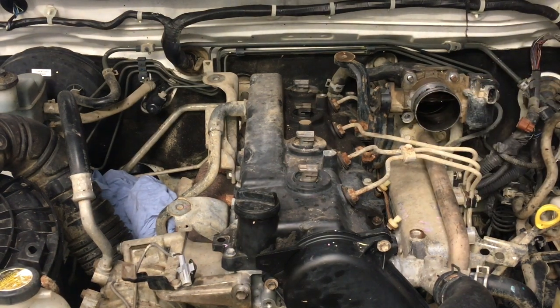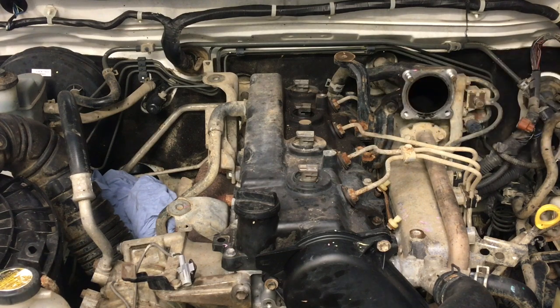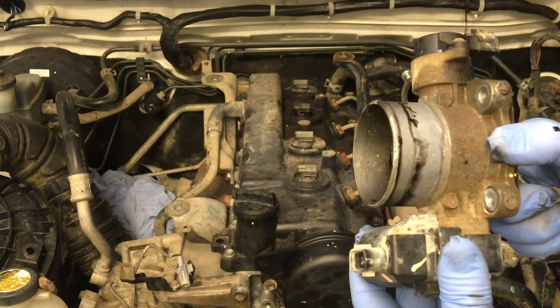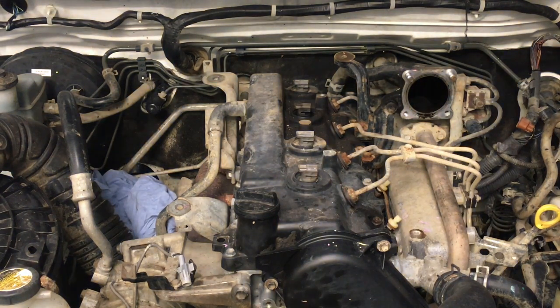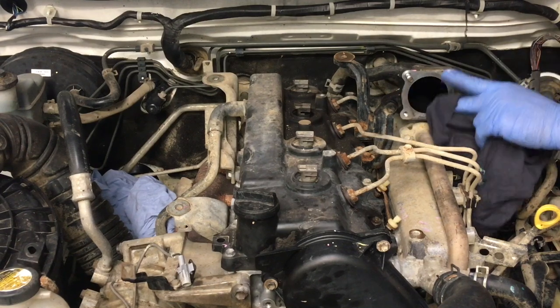To save a bit of confusion for you guys, don't throw these ones up on the sill. Take your throttle body, right? And I'll tell you, just the other day on a service inspection for the first time, I found bottom bolt missing and the top one loose, okay? So just beware who you let work on your vehicle. The two nuts and bolts, I'll go put these on the bench all together. Again, furthest away, just better order of business for you come back and you know where it all goes. Although it's all going to get changed up because we're cleaning all this up anyway.